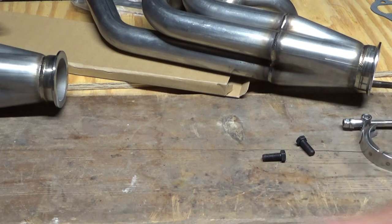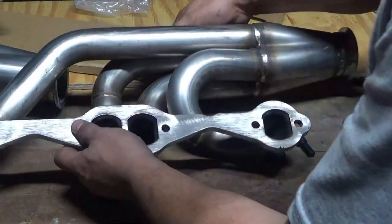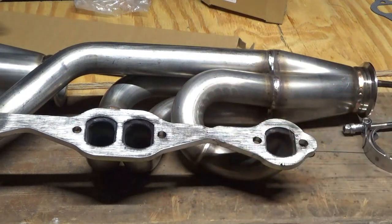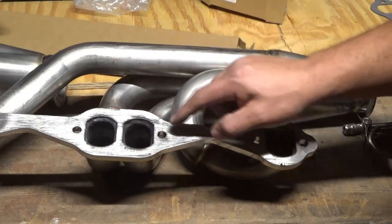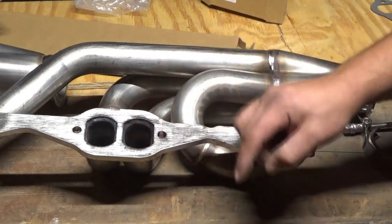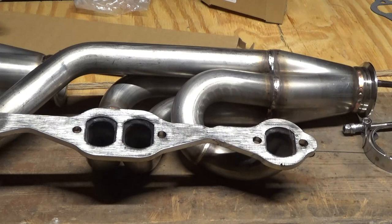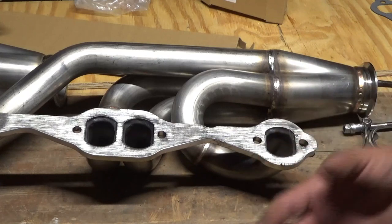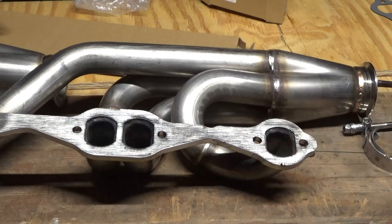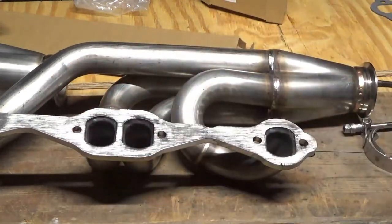A lot of aftermarket headers you buy with one and five-eighths tubes that are circles kind of have that problem anyway. One more thing about the ports - these are big ports, but I think they put a lot of thought into how to actually design that port, because it looks like it'll fit a stock head, and then it also looks like it would fit LT1 D-port heads. I think they really nailed it. Those are stock 305 heads - stock 350 heads probably have the same port, maybe bigger. And also on a lot of aftermarket heads, around the port a lot of them have a huge flat surface, so that way they could probably take anything.